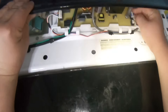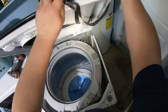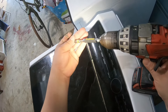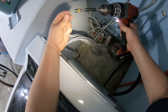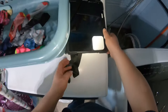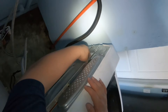Install the lid switch harness onto the board, set the display panel back into its clips where it belongs, remove your tape that was supporting the washer lid, and start reinstalling all five screws that you removed earlier. Don't forget to reinstall the drain hose back in place. Then reinstall the cover for the fill tube and wiring — this protects them from getting damaged.